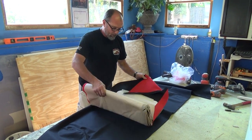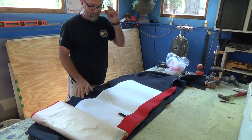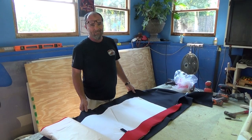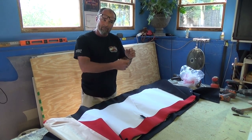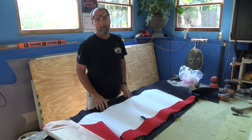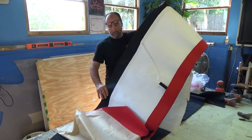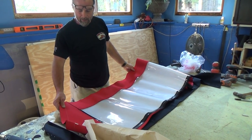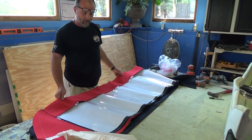The reason I bought the factory back glass is because it's already all sewn up with a zipper. I do make convertible tops with a hard glass on cars that don't come factory with hard glass — it's a lot more work and more money — but this car's owner didn't want the aggravation of having to pull the back glass out every time he puts the top down. With the plastic window you can just set the top down without taking the back glass out. You can order these in any color to match your top — I ordered a black inside and red outside to match this build.